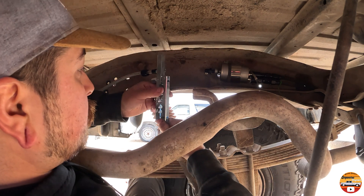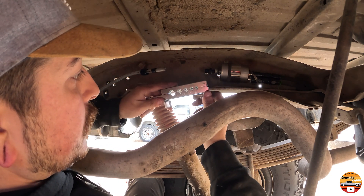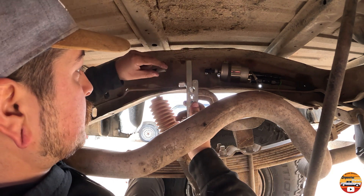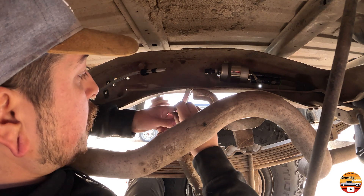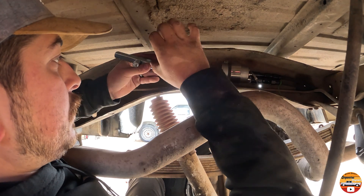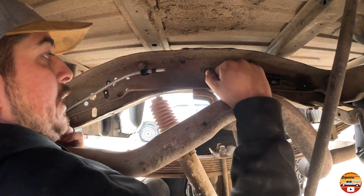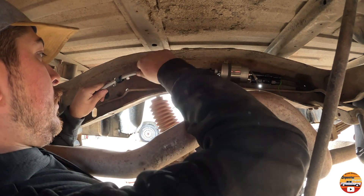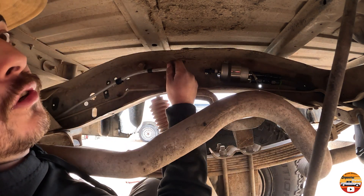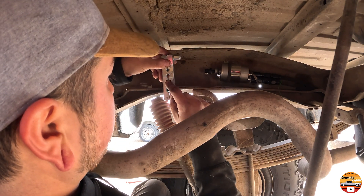We do need some special tools. This looks like a brake line flaring tool, but it's actually an AN flaring tool - it gives this tubing a 37-degree flare. It's a single flare, which means we only have to do it once. With brake line double bubble flares, you insert it, match the die, squeeze it once, flip everything around, and squeeze again. All we have to do here is ensure our nut and sleeve are on there, make sure we have a flat edge - which we do because we used a tubing cutter - and we're going to be using the 3/8-inch line.